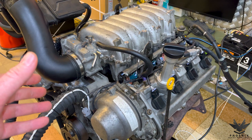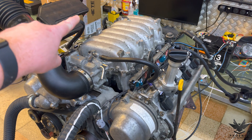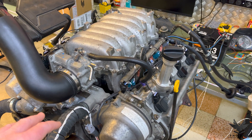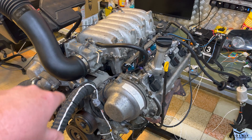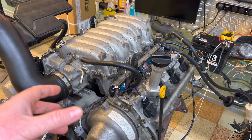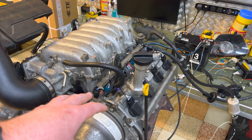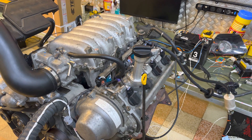Hopefully that's been a great demonstration. I've only done the video because I saw a customer in the same situation — he had to swap his air pipe around, so he was unable to connect that pipe. And I've also seen a couple of guys on Facebook posts complaining about random, unidentifiable misfires. They've checked everything, swapped coils around, and because it's a completely random misfire, they're not detecting it — and it's not easy to diagnose. So I just thought I'd let you guys know so you can see the difference between everything connected correctly versus that pipe being open to atmosphere. Hope that's been helpful. Make sure you've got no air leaks, and make sure that if you have that pipe connected, the other pipe is also connected correctly. Thanks for watching, and we'll see you again later.